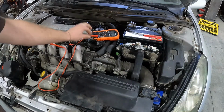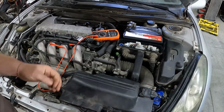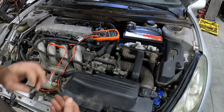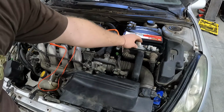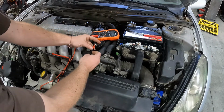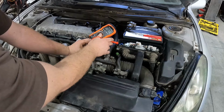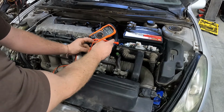All right, so these wires, including the crank wire, they both go into a loom, a section of wire that's got insulation on it that has an exposed cable that runs the length of it. Basically, if you ever break a wire, it instantly shorts it out, gives you a check engine code, and you know there's an issue. So what you can do, since the computer is grounded out, unhook your connector, check between each wire, grab one of the wires, and touch it to these ground cables. See if you can see that. And there should be no continuity. If there is continuity, that means that you have a broken wire.